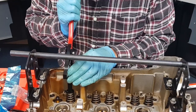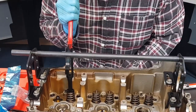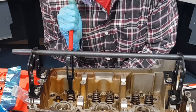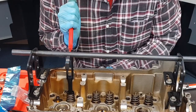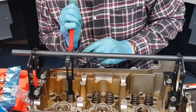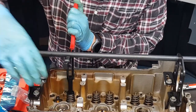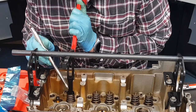To use the tool, just place this in here, line it up on the top of the valve, and then as I push this down it's going to try to push the valve down, so I've just lifted this off slightly so I can get my hand underneath to support it. Hear that click? That was as the valve is released upwards. I'm doing this with the head off the car — it is possible to do it with the head on the car as well, in which case you would remove the spark plug and use compressed air to hold the valve closed.